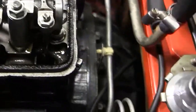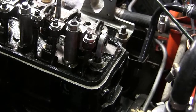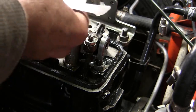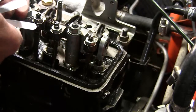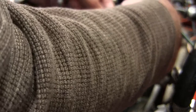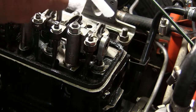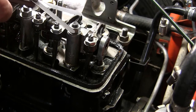Then these two should be equally open. These are closed — these are the ones that are on the rock. I'll check with the feeler gauge, see what we've got here. Three thousandths. I can't use a feeler gauge to do this — that's why I like the dials. Because the rocker is on the valve, it's got pressure there. So setting 40 thousandths and then trying to measure it — hell no, you can't.